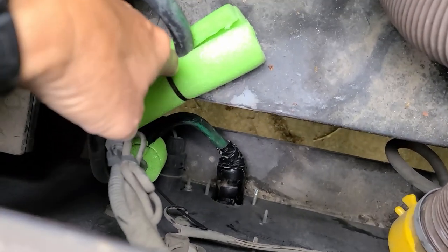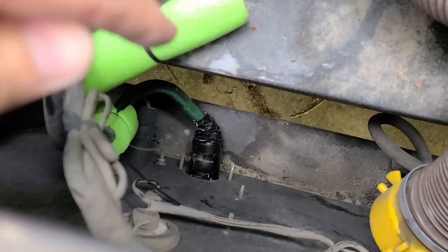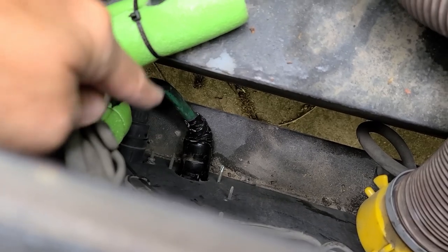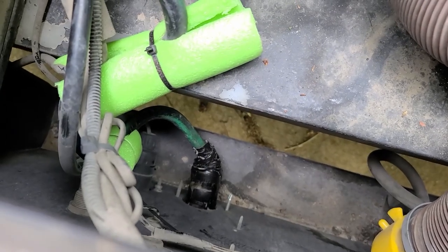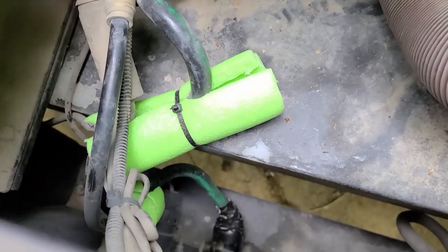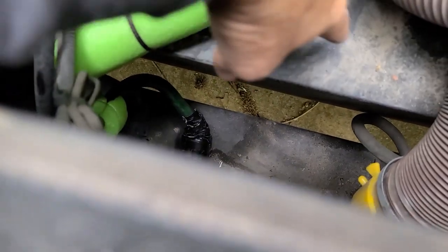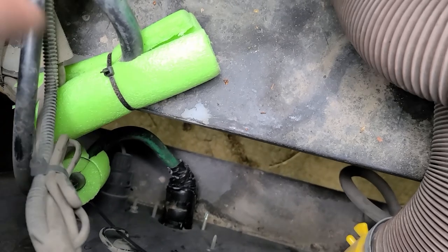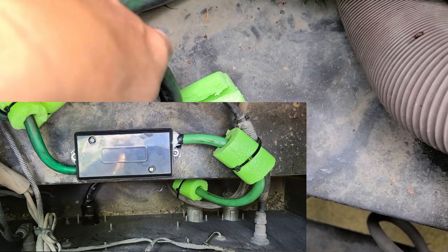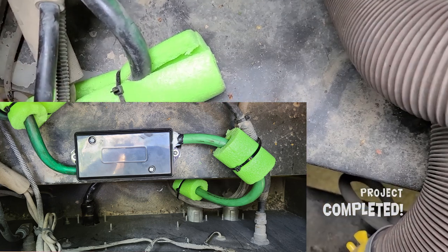So I've added some cushioning right there on our dump tank. But right down there, as you can see, there's a strain as it makes that hard left, just because of space and because this wire has a lot of tension on it. So I'm going to install a gang box, probably right here, and I'll connect the plug into that gang, and then connect the cord from the truck into that as well, and that'll make an easier connection and put less strain on that plug.